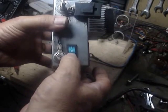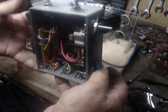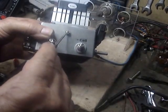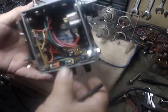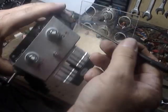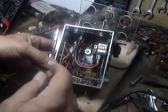This one has the digital amp meter, also the master power switch, and this one here would be for the ignition switch. The only thing you have to do is it's completely plug and play now. All you have to do is put it in your car, attach the wires to the battery, the wires to the cell, and the wire to the ignition. Then you've got your master switch, your digital amp meter, and it's got a one-minute delay-on timer.